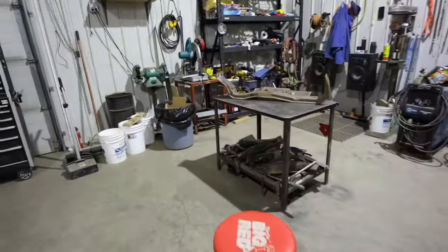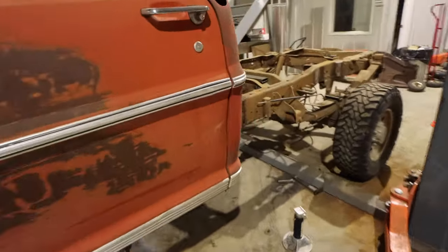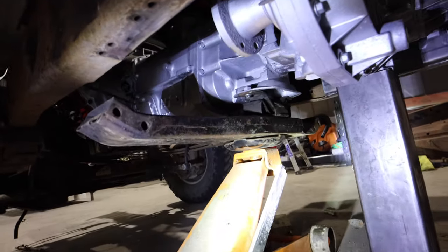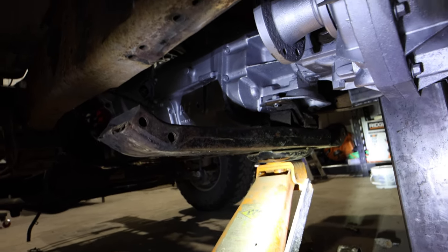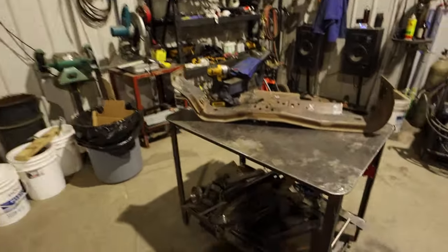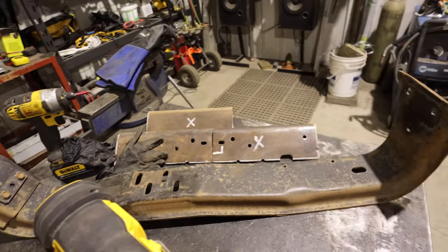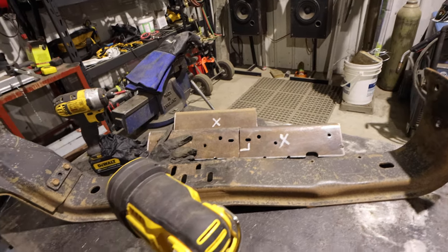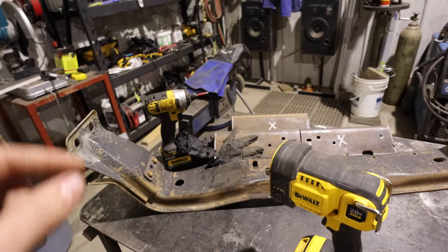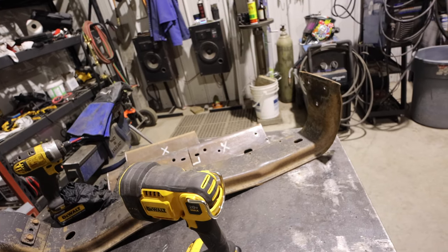Here's what we're up against now. We've got the crossmember from the '99 F-350 which fits the frame but doesn't fit this transmission. Right now we've got the transmission sitting on the stock Dodge crossmember, which is bolted to the transmission. My plan is to cut the two together — I'm going to cut this piece down right about here and get those pieces mounted to the frame, tack weld it, then build some gussets or plating to make it strong.